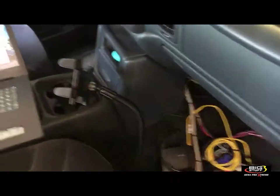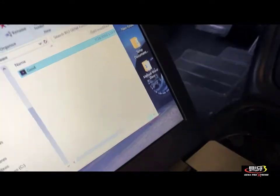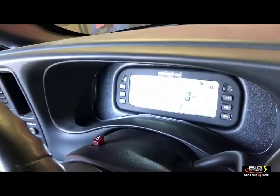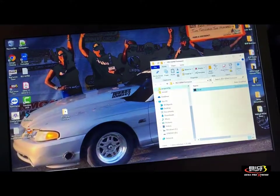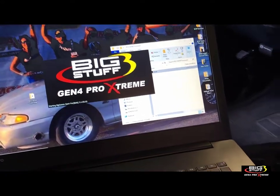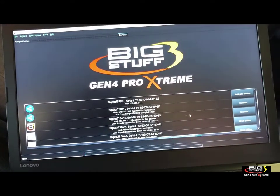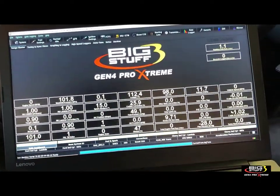Come over here and turn the key on. I've got my RacePack dash — there's my data, though there's a bad glare. I'm going to come over to my software, fire it up, and make a backup first. When a firmware update is applied, it's going to wipe everything out, so the first thing you want to do is go into the software and load everything up.